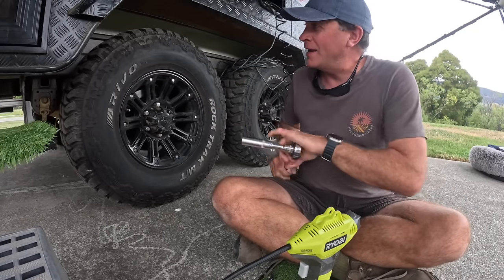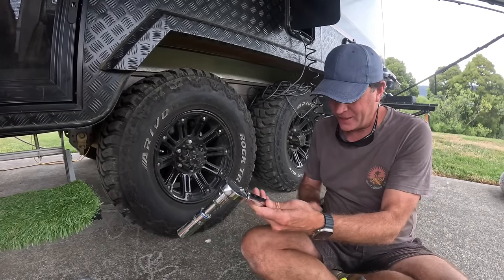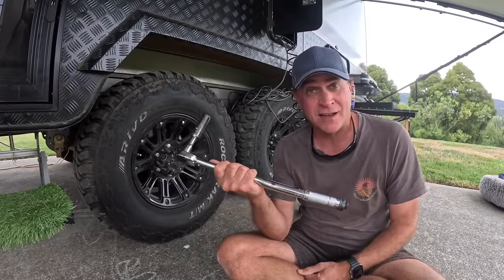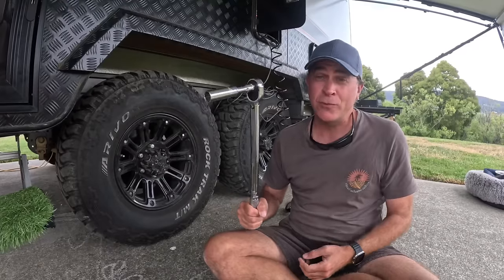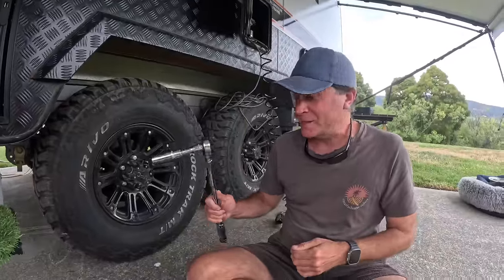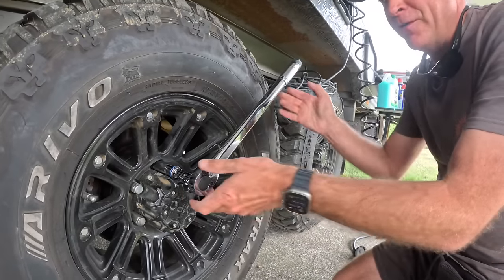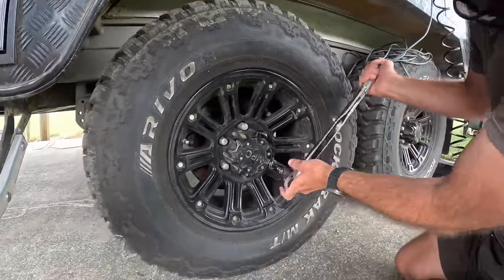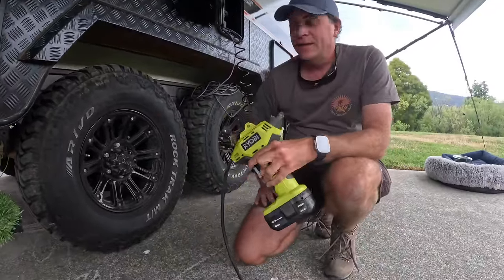The other super important thing about our wheels is the amount of torque on the nuts. This particular muddy tyre needs 105 foot-pounds of pressure. You've got to get yourself a torque wrench — not going to cost you a lot. You can get ones for $50 at a hardware store; I think this one cost us about $100. This is super important because we've found quite a number of people on the road who have lost a tyre. You've got to do this every couple of weeks. Put it on the nut, pull it down, and when you hear that click it means the pressure is perfect. Go through every single one and make sure every nut is at the right torque. Get yourself a torque wrench and a little portable compressor — it'll save you a world of pain.